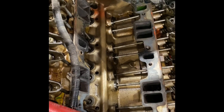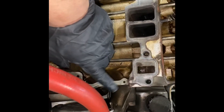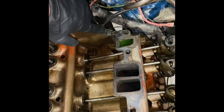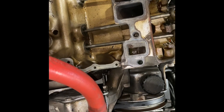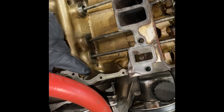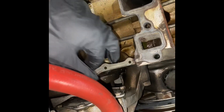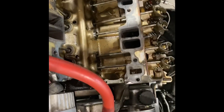It doesn't look very clean but there are no ridges or raw material, so I'm going to start putting on my Fel Pro gaskets and some gasket maker. The kit did come with gaskets that go along the edges, but they can be a pain — sometimes as you start tightening it down they'll slip out. To avoid that I'm going to go straight with RTV; if it squishes out you just wipe it away and don't have to take everything apart again.